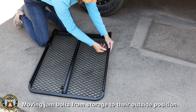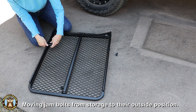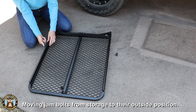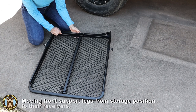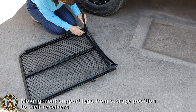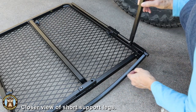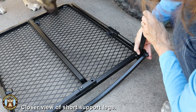The setup of the tire table is super easy. It has two jam screws that hold the slide in place during travel, and you unscrew those and then put them on the outside of the frame — don't tighten them up all the way. There are two short legs that provide the front support on the tire to hold the table in place. Those travel in little slides and have push-button releases. Remove those two little legs from their travel positions and slide them into their receivers.